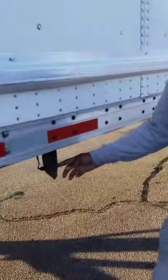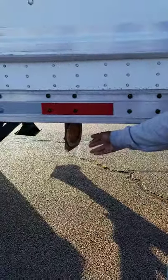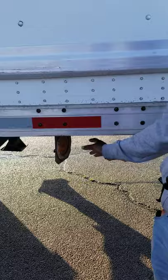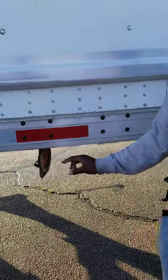This is a multi-functional light. It serves as a left and right turn signal, 4-way flasher and a marker light. It's amber in color because it's at the front of the trailer. Not missing any nuts, bolts or screws, not been broke or cracked. It's functional and operational and properly mounted and secure.